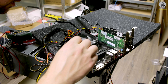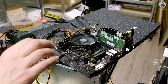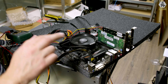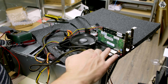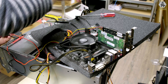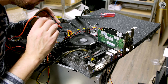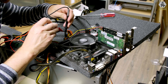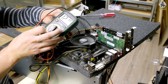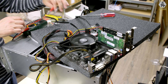It's just a Ryzen 3, so it doesn't get really hot, but it's wise to connect the CPU fan anyway. Now we're up and running again — the RAM doesn't get too hot, the voltage regulators don't get too hot, and the CPU is working fine. After this step, I built it back in the case and put it back in the rack. I measured it twice just to be sure, and we see a nice 12 volts on the Molex.